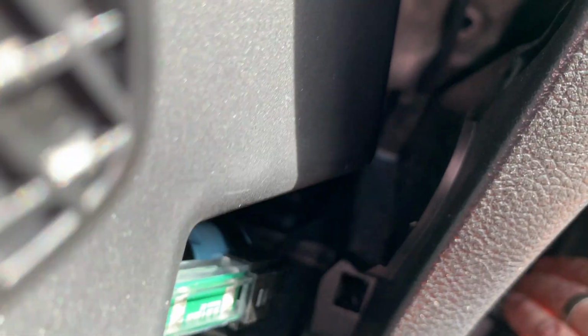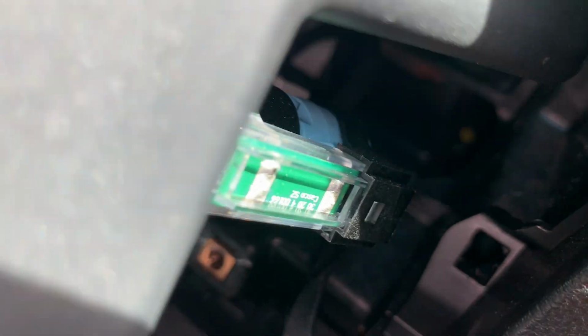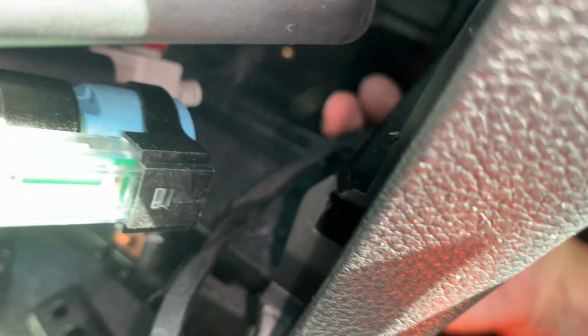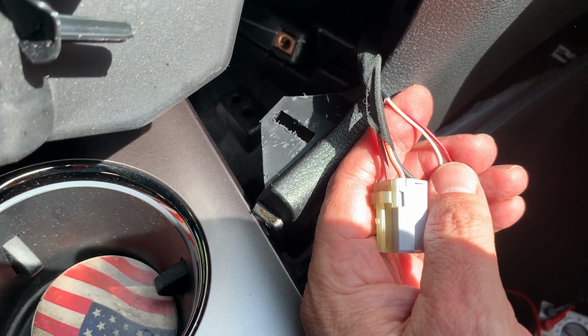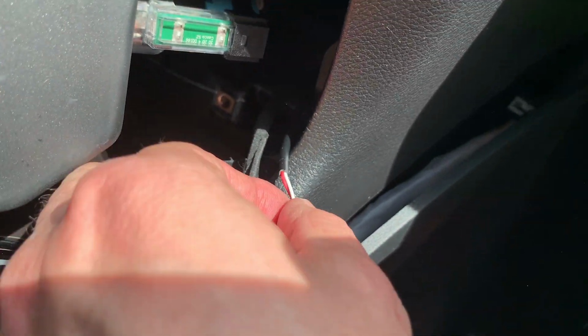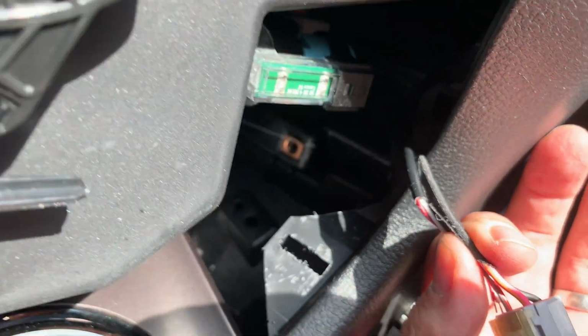Once you get the wire over here, you want to push it up through that channel. So I'm going to show you what I'm talking about here. I'll just use my hand. And the electrical cable, sorry, I'm covering myself, hang on. You should be able to see my fingers. It'll come right through the side, right up through this channel, and pull it right out through there. And talk about just enough cable. I mean, it came out right. It has no more slack. So we'll be able to splice those in to those wires, set everything back together.